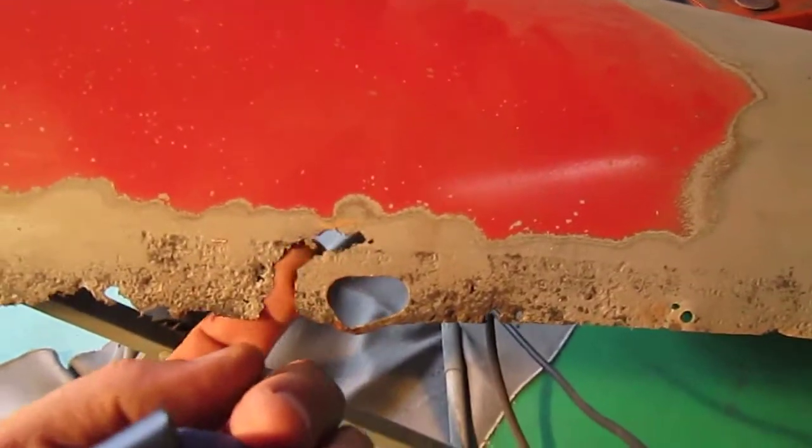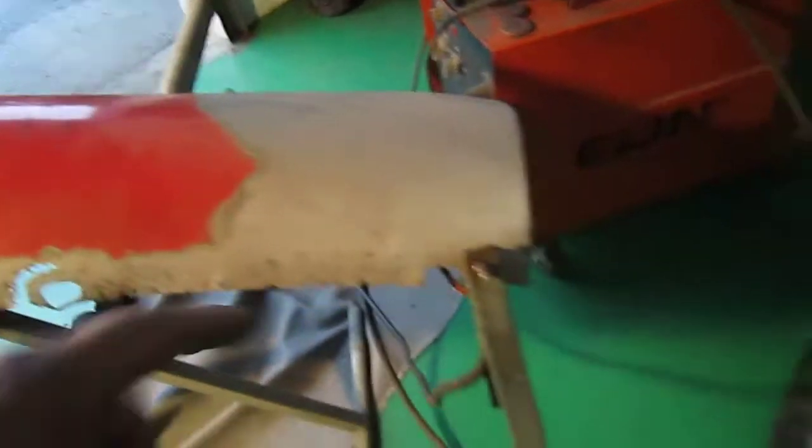You can see it's quite bad there. The problem with this returned edge here where it's bolted on is it actually sits right under the car, so you can imagine all the dirt and crap that sits under there. So this is a big job as well. What we'll do is sandblast the car, and then when it's on the rotisserie and I can turn it 360, I can turn it over. We'll cut them off — probably cut it off here — and build a new angle to go onto these wings, this rear section.